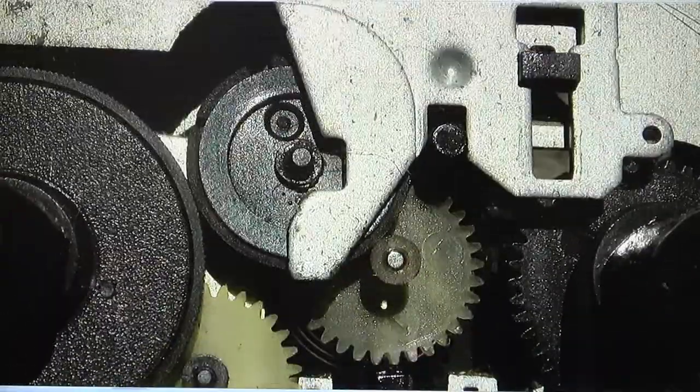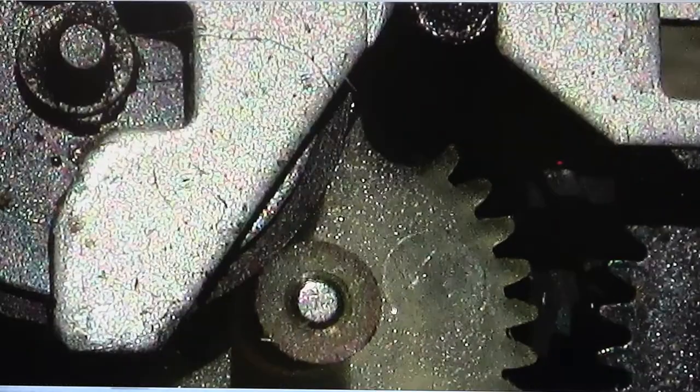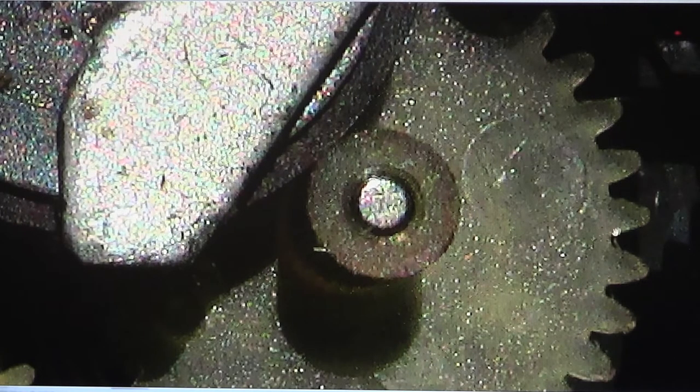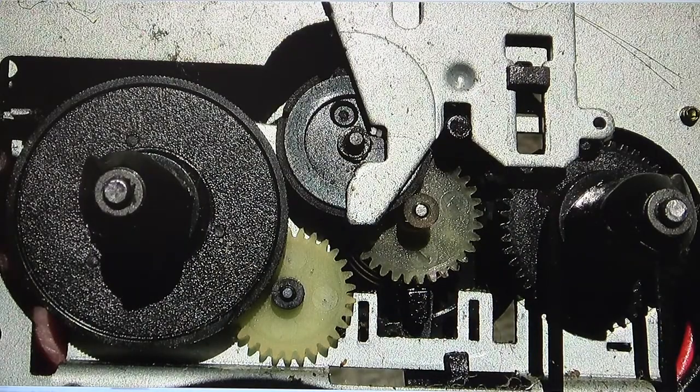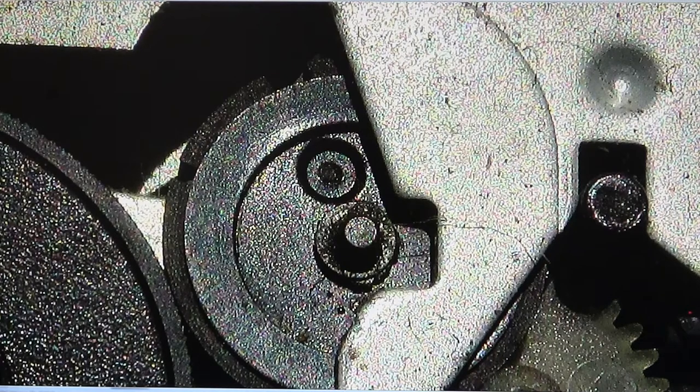Here's another picture, somewhat better, of that tire. Again it hadn't moved much, but as you can see it's missing — you've got rubber, blank space, and rubber. That's not good. There's another crack right here in the rubber. So that tire is your take-up reel spindle tire, and it is driven by this right here, which is the spindle off the end of the jack shaft. The outside gear drives your fast forward and rewind as it flips from one side to the other. This is the idler tire, which I'm always preaching about — you can change the belts all you want, but when this idler tire goes bad, nothing's going to work.